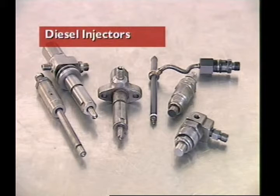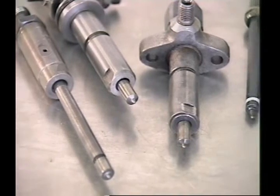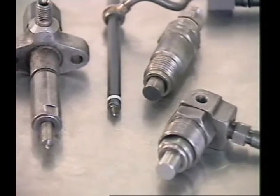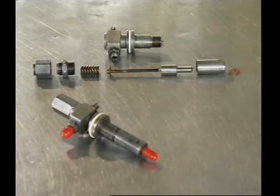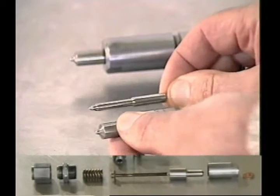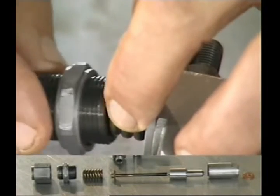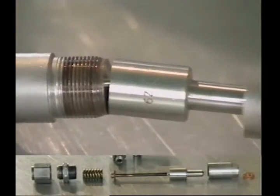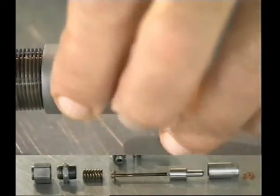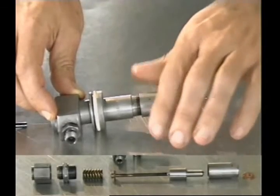This section examines diesel fuel injectors. Most diesel fuel injectors use the same basic design, made from heat-treated alloy steel; the actual shape will vary according to the application. The injector assembly has several main parts. The nozzle assembly is made up of a needle and body. A pressure spring and spindle hold the needle on the seat in the nozzle body. A nozzle holder, sometimes called the injector body, may allow for mounting the injector on the engine and some method of adjusting the spring force applied to the needle valve.